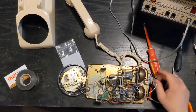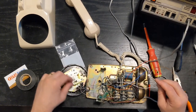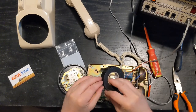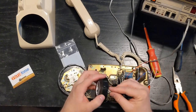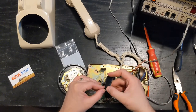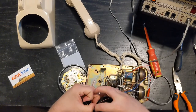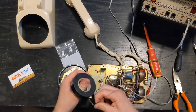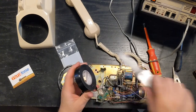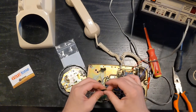The last thing should be our brown wire, and that is going to go to the other white wire from the dial. Just pull that out and, as before, a little bit of tape. If you're looking for something more permanent, you can always solder these together as well. I'm not great at soldering, I'll be the first to admit it, so I tend not to do it if I don't have to. When I started this project, I selected phones that I specifically knew I would not have to do any soldering with. Some of the older models you will have to cut and re-solder some of the wires because the terminals will be soldered in place and not these nice connectors.